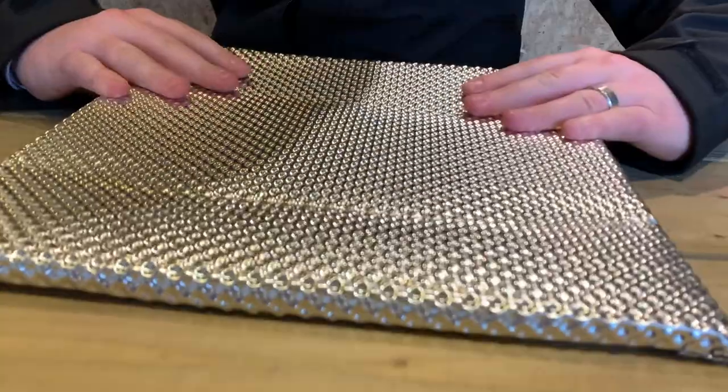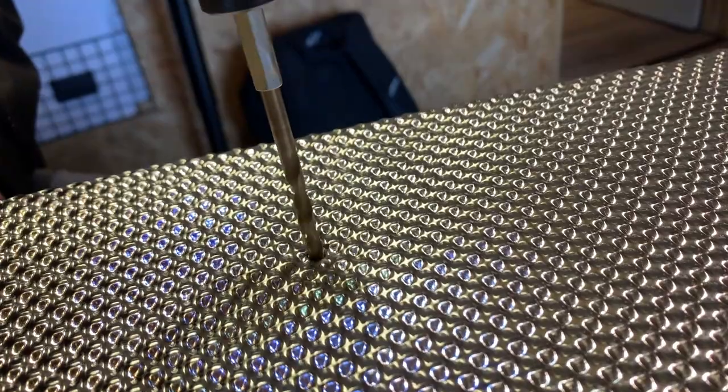The first option we're going to be looking at is our dual layer barrier sheeting. This is very effective against the higher levels of heat transfer and actually retains that OEM look. It looks very standard, but at the same time it's very easy to shape, mould, drill and secure in place. As you can see here, it's actually very thick, so therefore it can be very effective either in contact with an exhaust system or just put on your bulkhead.